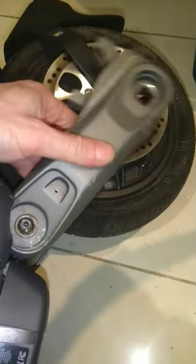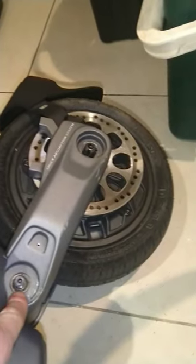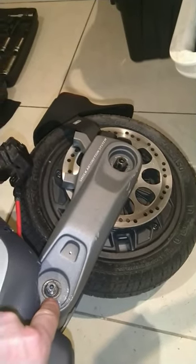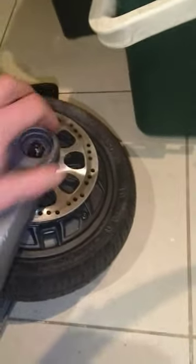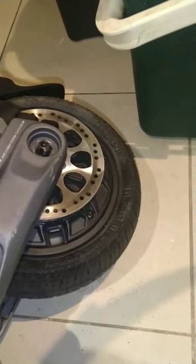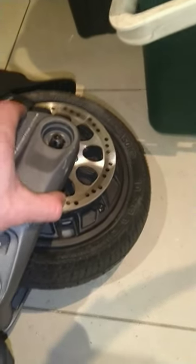This is the round side. I thought there was something wrong with it because it was wobbling, but what had happened was they had a little fabric or fiber washer in here and that had got destroyed. The suspension was moving because that doesn't articulate — it stays still — and you just need a washer underneath it so that the nut doesn't back off when that moves.